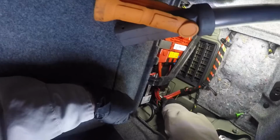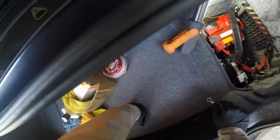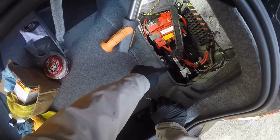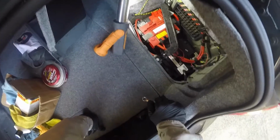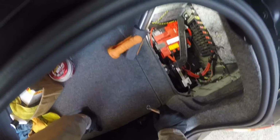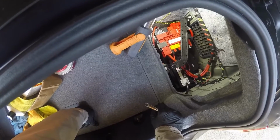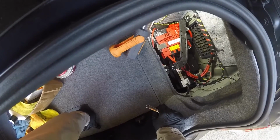But we're having some charging issues, and my partner grabbed a battery charger and went to the battery back here. He hooked the negative cable up to the negative side. He found the positive terminal on this side, and when he hooked up the charger and put it on just a 10 amp, the airbags deployed. It busted the front window, side curtain airbags went off.